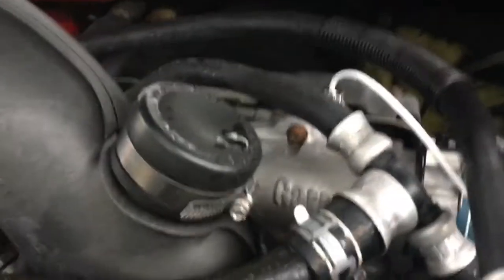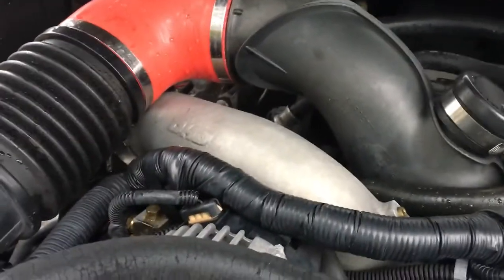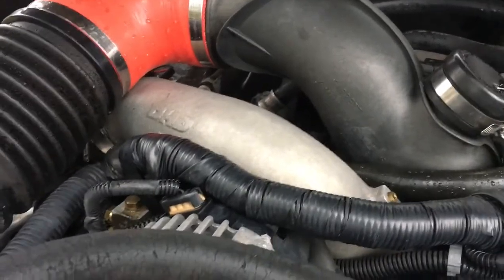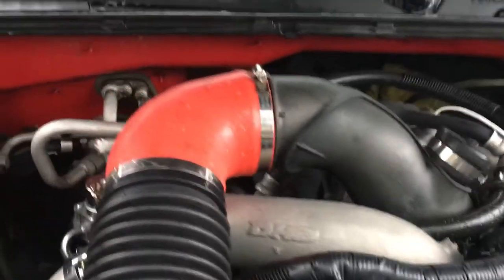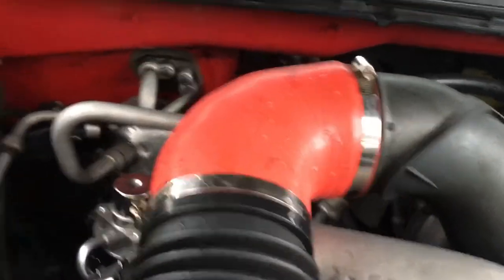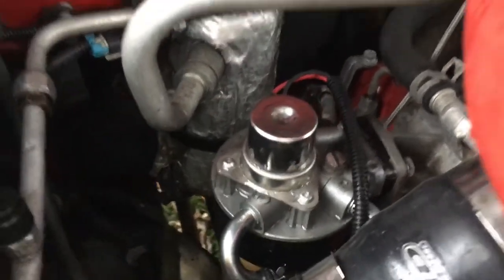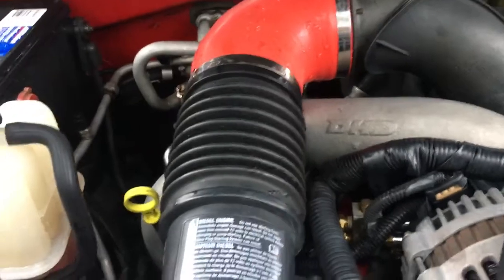Garrett 3794 Turbo Stage 2 from Danville. DHD Y-bridge intake combo kit, full EGR delete, PCV reroute, MBRP 4-inch downpipe, LB7 up pipe for the passenger side. That's a new filter head with a CAT adapter on it. It was on it from day one. It's got LBZ intake, obviously, with a custom intake there.